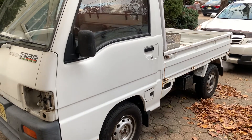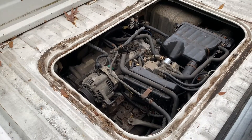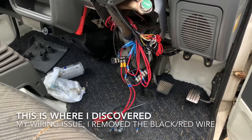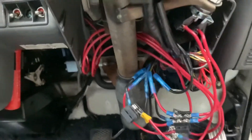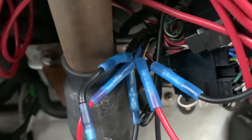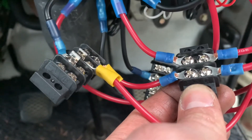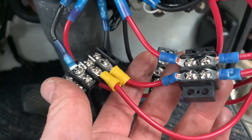The truck is running. I need to work out an issue with how I had the starter wired, so a lot of this is disconnected right now. This is how the wiring would be, except I'm running into some issues. Coming off what used to be a plug, we now have a bunch of insulated ends. I removed the bridge that was connecting the start and the ignition to the same power supply that was sending power to the starter all the time.